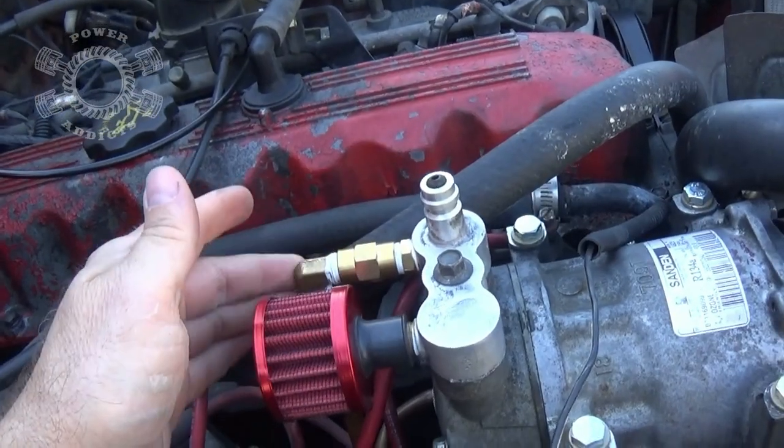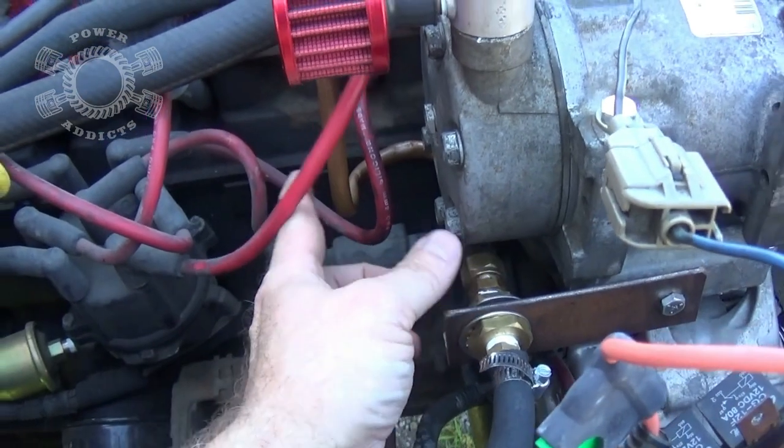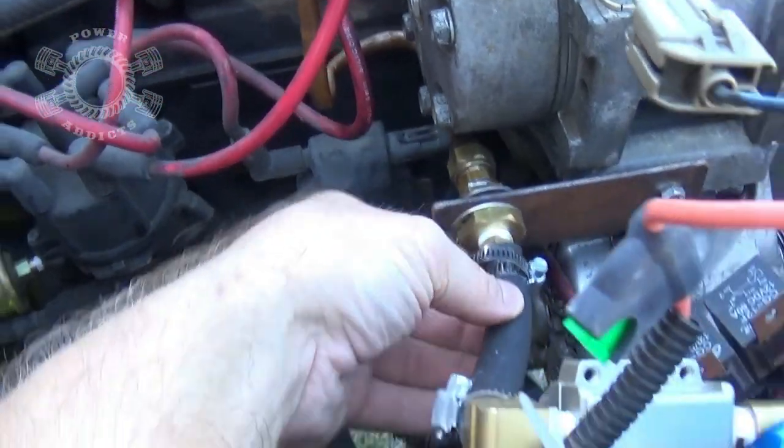So coming off this right here, with just a short section of copper coming down under the compressor into here, the copper dissipates heat very well. That allows it to cool off before it gets to the rubber connection that goes from here up to the manifold. Down in the description, I'll provide a link to the plumbing as well.